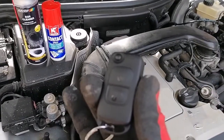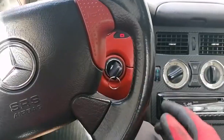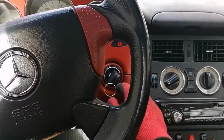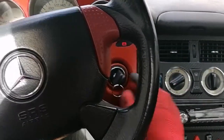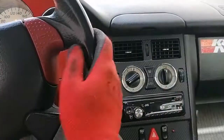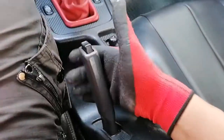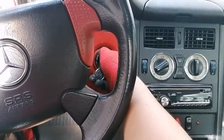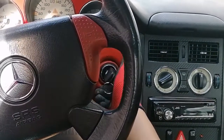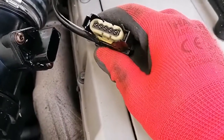We'll put the key in and start her up. As always when you're working on your car, put the key in the ignition so your alarm doesn't trip, roll a window down so you don't lock yourself out. We're not going to disconnect the battery of course because we need the engine running. Make sure it's in neutral, handbrake on, and let's kick her off.